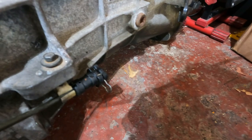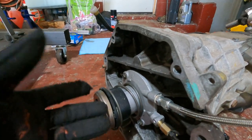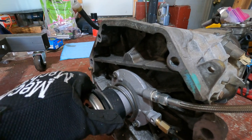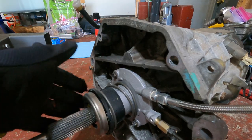You got to disconnect this line anyway because you're going to be shoving a new line in if you're doing the stock style. I'm not doing a stock style - my slave cylinder is getting changed out to a Tilton, and obviously my master cylinder is going to be a Tilton. It's going to be done a little differently, but at least you can see how it would go if you're just going back to normal. If you're going to a stock slave cylinder, you got to take the transmission out. There's no way around that. You got a couple bolts, they come out, and this thing self-adjusts.